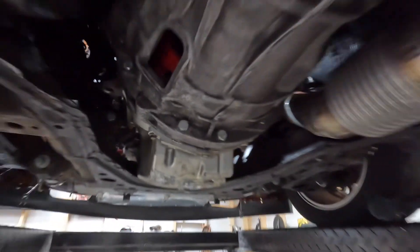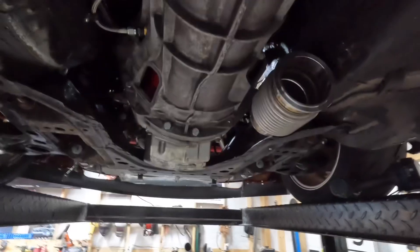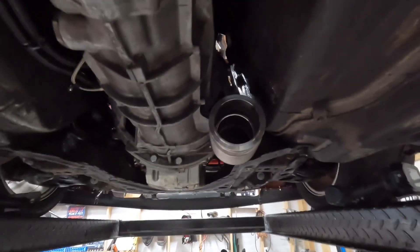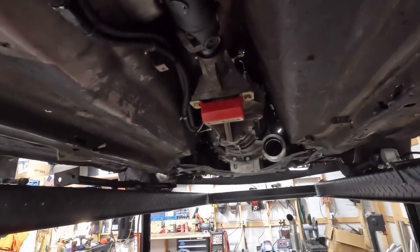I was out of town while he did the majority of this work, but while the car is already on the lift I need to change out that pilot bearing. I'm going to pull this down pipe out, and Jacob needs to add a V-band after the wastegate merge — right about that area — so this section can get pulled out. I'll lower the car, get as much undone from the top, then pull the driveshaft and trans.